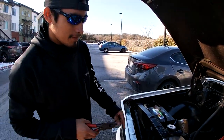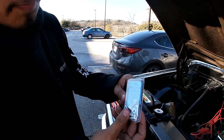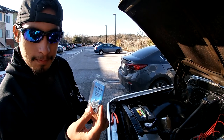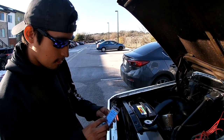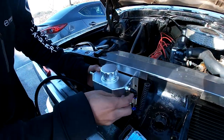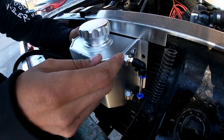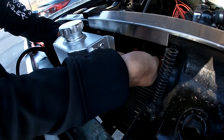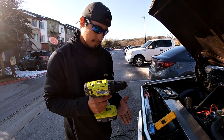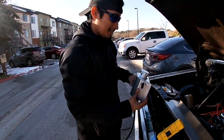We have to make new holes for the new reservoir. I got some screws right here — I couldn't find any lock washers but in the future I'm gonna buy some lock washers and extra washers so they won't fall off when I'm driving. I have to drill some holes on the reservoir so we can go ahead and install it. We're gonna drill through here too so we can put it on the support for the truck.